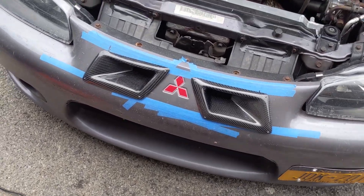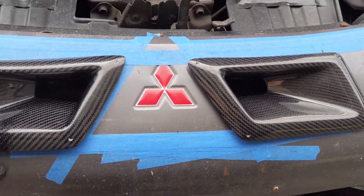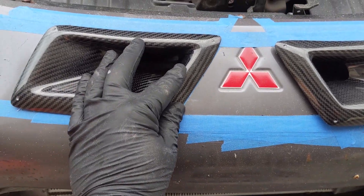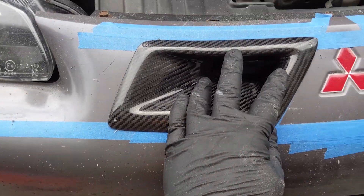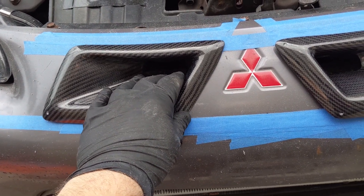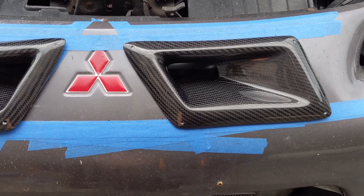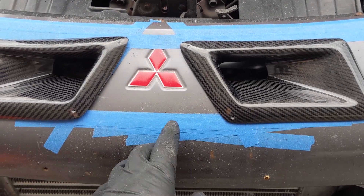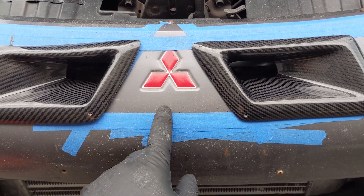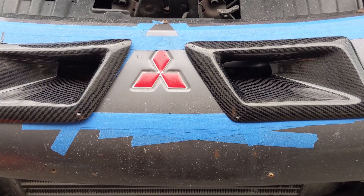My little tiny cuts are done. These are just sitting in the holes I made. Take this off and you can see the opening - this is going to sit just like that. I'm going to screw it in and the cuts are actually perfect. There's a little extra space on the back side but that's fine - I wanted more room for adjustability. Now I just have to get these two lined up square and fasten them in. I'm going to start peeling the tape, cleaning the area up, washing the bumper off. There's a lot of fiberglass dust - definitely wear gloves, a mask, and glasses when you cut a bumper because fiberglass shoots everywhere.